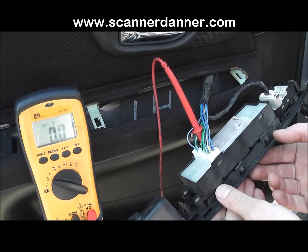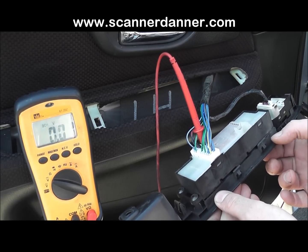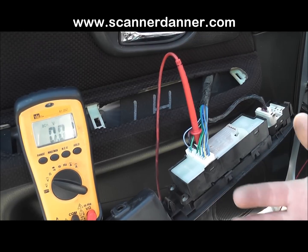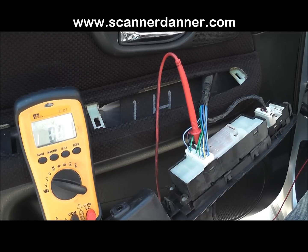So when I turn the switch on and I either lock and unlock the doors, see how my voltage stays very low? Now I'm seeing a slight voltage increase, but a slight voltage increase would be normal because there's now current flow on that ground. But did you notice how low the voltage stayed? That would be how you check your switch ground. Switch ground is good. If in this case, the door locks didn't function at this point, you checked your switch ground, you did your bypass test on the two wires, you're done. Put a switch in it. 100% confident. Pull down, switch input, circuit identification, using a voltmeter, and showing a bypass test.